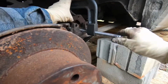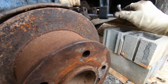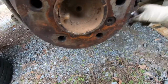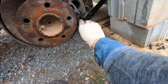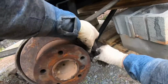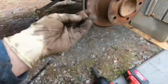These brakes don't fit. Now I have to squeeze the cylinders. I have to remove the pads. I decided to skip over all this because it's a lot of work, and there's no reason for you guys to be looking at that. So I'm already replacing the brake calipers. I left the brakes, but I squeezed the cylinder on the brake caliper so it can go back and I have enough room to reinstall it, because these are different rotors, and it must be done for both sides now.